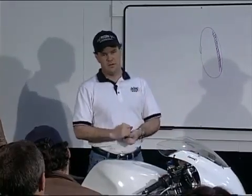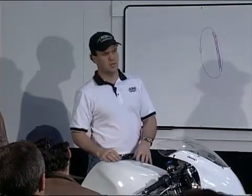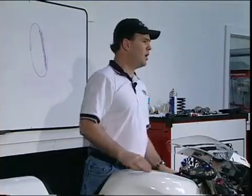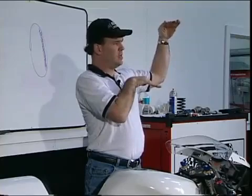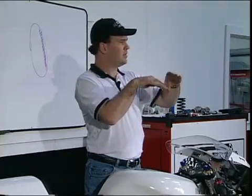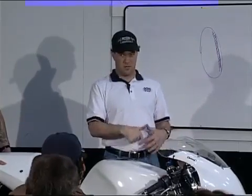Now, too slow a rebound, too much rebound damping in the fork, all right, can make your bike wobble, because it's going to hold it down. It's called packing down. Too much damping will actually make your fork work like it's going down a set of stairs, doop, doop, doop, doop, and it'll just stay down there, get sucked down and held in the bottom of the stroke. That's where the spring pressure is high and where there's very little travel left, and the fork will just get stiff, right? Because the spring down there in the bottom is stiff, and the fork's not responding, okay? So we want that thing to be able to relax and come back to its normal attitude, right? And be ready to soak another bump, not get sucked down and stay down in the bottom of the stroke, right?